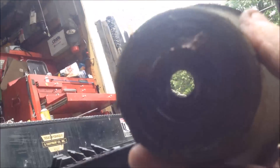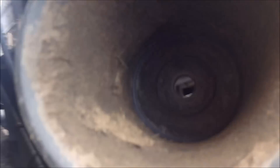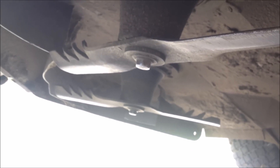Here's a better shot of that washer — let me get it in the sunlight. There we go. If that washer is not in there correctly, your blade will get tight but it's going to be canted or cocked to one side and it'll vibrate. Let's go ahead and get the rest of these off and see how she turns out.